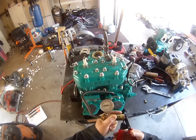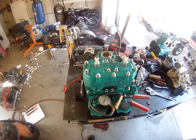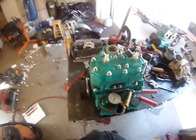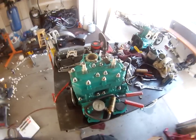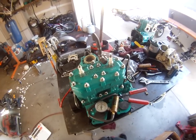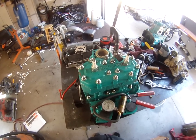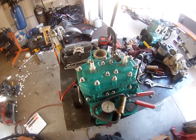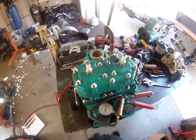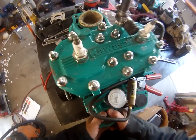You saw it didn't take very long to pump it. Now we're just going to set that there and watch it for about 10 minutes. As long as it holds a vacuum, that means the seals in the engine at least at this point are good. That doesn't mean the seals aren't dry — after a short time the seals could go bad. All it means is that at this very moment the seals are good and it's holding a vacuum, and that would be your indication that you're okay. Now while it's sucking I want to make sure that I've got a good seal.